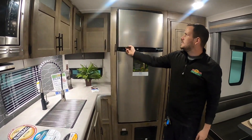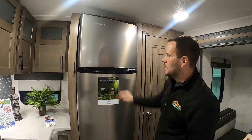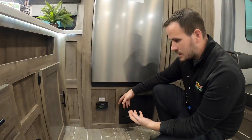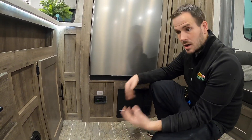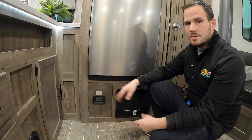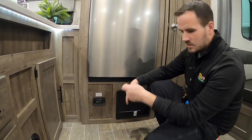The 12-volt refrigerator in these units is a newer model from Everchill. They run 12-volt constantly, so they don't use an inverter or 110 — they're always running off the battery. You can run them while you're driving to keep them cool. It's got a travel latch on it. Down here you have your LP leak detector and carbon monoxide detector — this detector is hardwired, so it's always on. Because of that, when you take the unit home and won't be using it, it's best to disconnect the negative off the battery. The backlighting to the radio and a couple of hardwired items will drain your battery fairly quickly. You can also have a battery disconnect installed so you only have to flip a key.